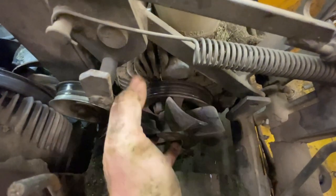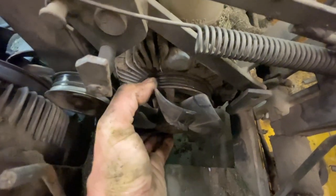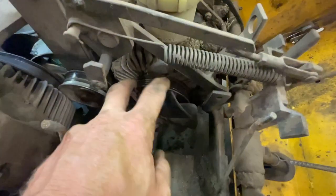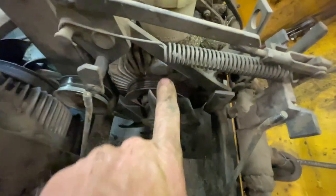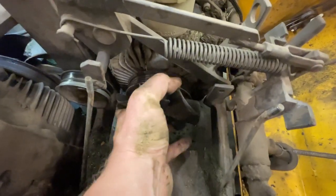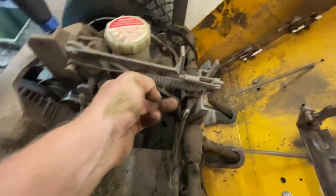There's a pretty good amount of play in that hydro shaft — I've replaced this front bearing already once. But don't be alarmed — there will be a little bit of play. For whatever reason it still doesn't leak. The way it's designed, the shaft going through is actually free-floating and goes into a spline, so it's not directly connected to the hydro itself. It works and seems to last pretty well. Let's go ahead and disconnect the rest.